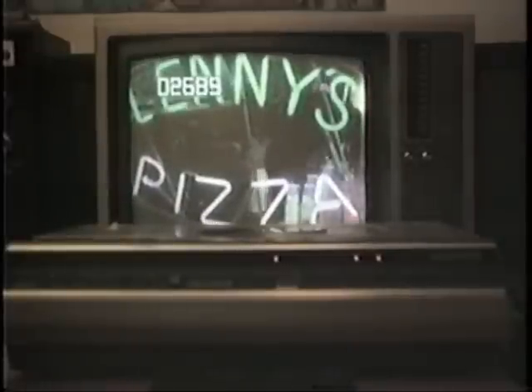As I said, there are two audio channels. Take them both out and you get nothing. Here's the right channel. Here's the left channel. And here are both channels. Movies that are current or a couple of years old, if they're released on Laserdisc, they are probably released in CX encoded stereo, which is very, very clean sounding. Here's something I kind of liken to beta scan — this is picture search. This really rips through the disc really fast. In fact it's so fast, they've cut out the last two digits on the index counter — you only have three numbers now. You can go forward or backwards. This does not harm the record or scratch it, because this is read by a laser — there's no contact with a needle at all, so no harm done to the disc.